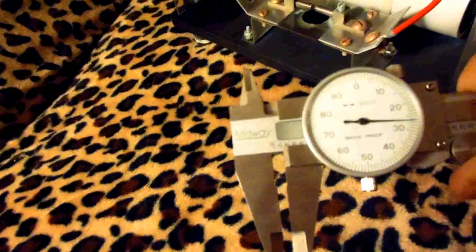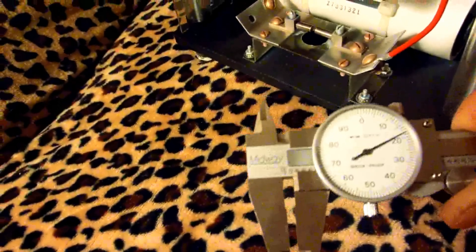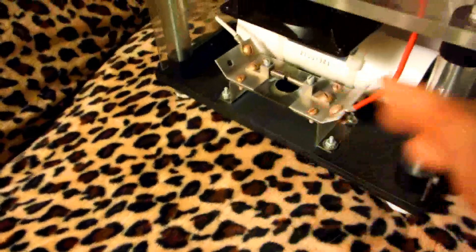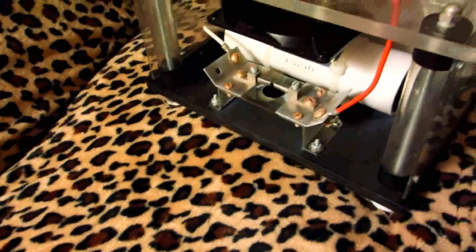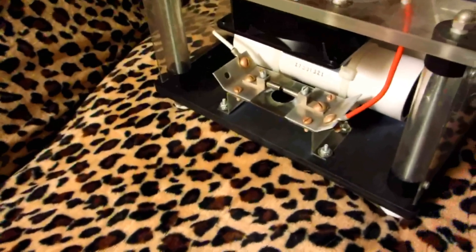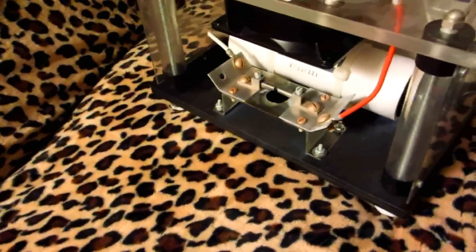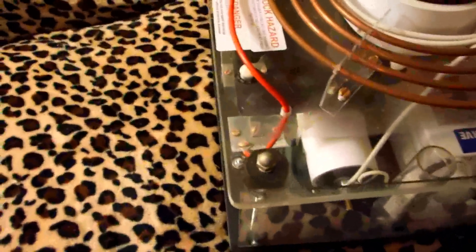I think at the factory it's set right at 125 thousandths — an eighth inch. As this wears down you're going to have to move these electrodes in if you use it a lot. I've been using this about an hour a day — not an hour at a time, but four 15-minute sessions or three 20-minute sessions — and it still works fine.